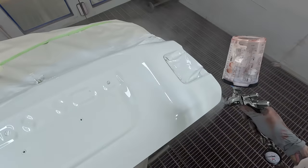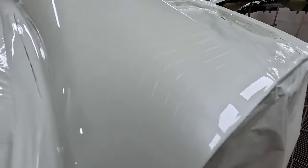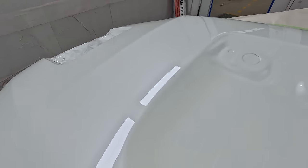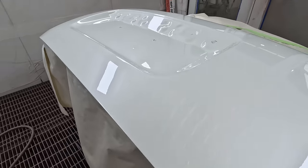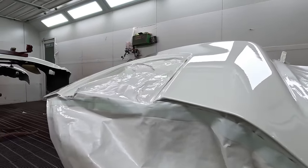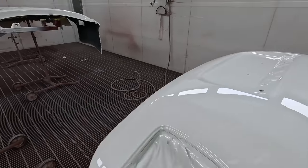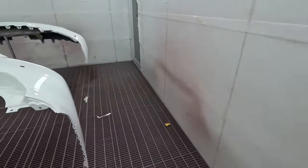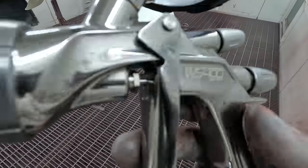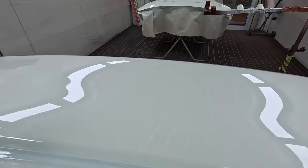On the other hand, you can get runs with it really easily. If you look at the fan side-on you'll notice it has very sharp edges - they don't curve around. This was really noticeable at the start of the video when I swapped straight from the Supernova to the GTI Pro with the TE20 air cap, which has very rounded edges to the fan. Basically anywhere you've got a shape on the panel it'll go heavy top and bottom because of those sharp fan edges, and you will get runs very easily.